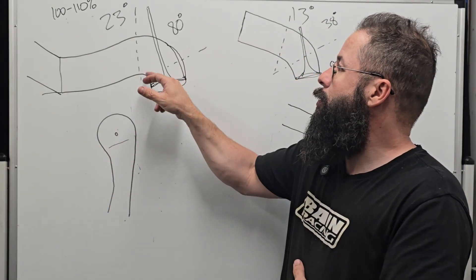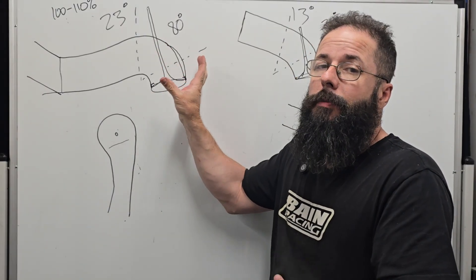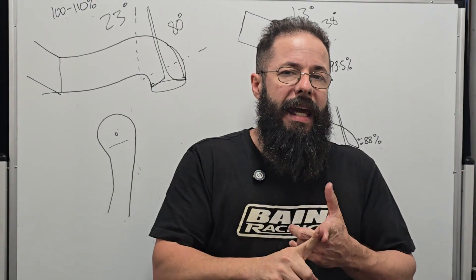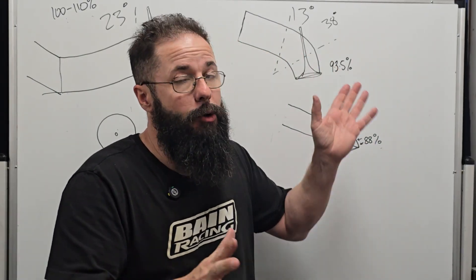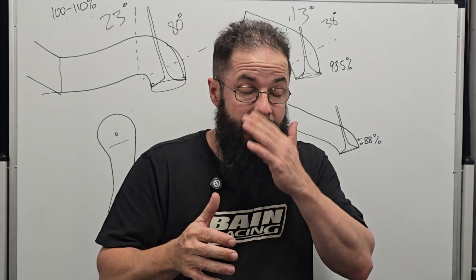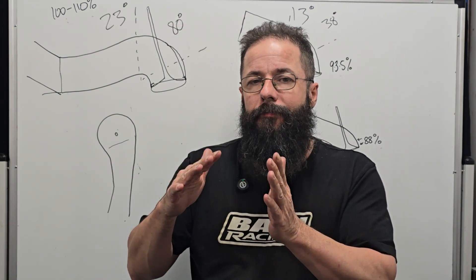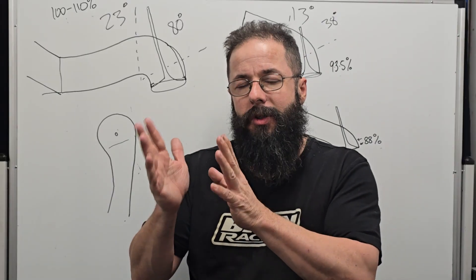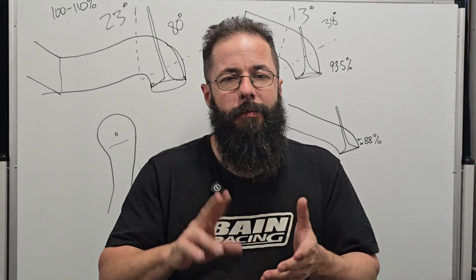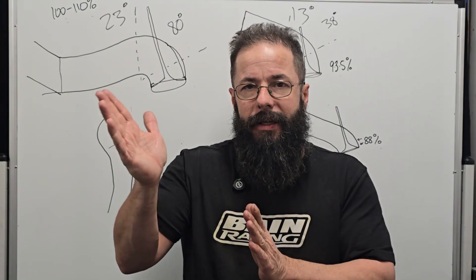The idea is to have a denser, greater volume in the bowl. But that doesn't work in twin cams, or even in some of the latest cylinder heads, and it doesn't work when we move away from limited RPM type applications. In dirt racing, they won't want as big a bowl because they want response — they're not looking for peak numbers.